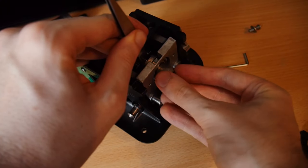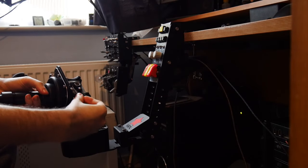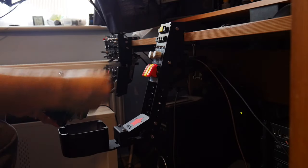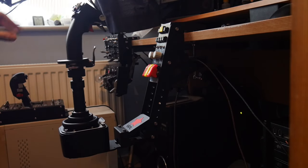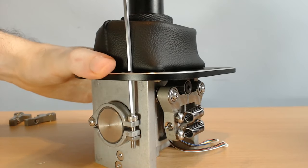Hold the retaining nut in place with a pair of tweezers when you remove the bolt, and then attach the damper brake drum. You adjust the resistance with the brake tension bolt — too much will cause the axis to stick, giving the dreaded stiction phenomenon, making small inputs difficult — so avoid excessive pressure. This significantly helps prevent unintended stick wobble and improves the return-to-centre handling. It's not as nice as the dry clutch system you'd find on the Super Libra, but a very healthy improvement over none, making it a great choice for extended use.